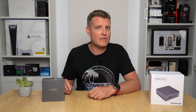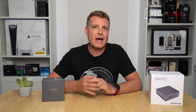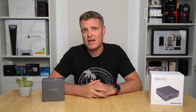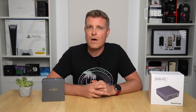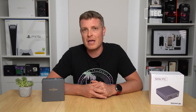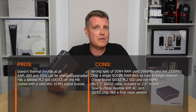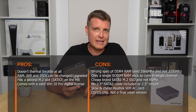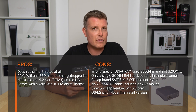Overall I'm disappointed — this machine has potential but they've installed a single SODIMM at the wrong spec (2666MHz instead of 3200MHz), a cheap Realtek wireless AC card instead of an Intel AX200, and a SATA 3 SSD instead of a faster NVMe. The M.2 slot does support NVMe. To get the full potential out of this mini PC you'd really need to replace all three components — install your own wireless card, correct dual-channel RAM, and an NVMe SSD like a Samsung 970 Evo Plus.